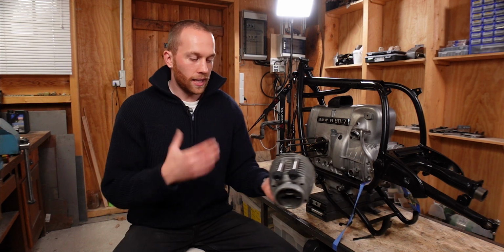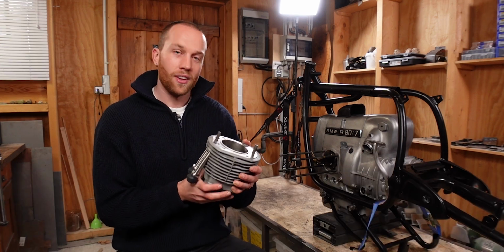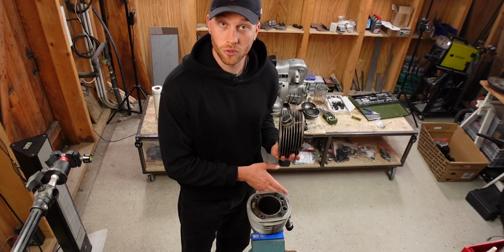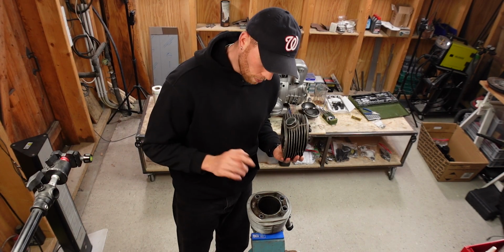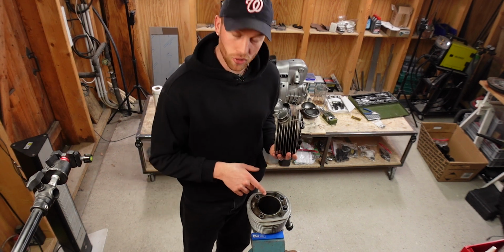But over time, I gained a lot more confidence, and now tackling the pushrod tubes, for example, is something that I definitely dare to do. But I didn't expect to find more problems. I haven't even started to touch the pushrod tubes, and I just took a peek at the cylinder walls. And unfortunately, you can see that there's not much cross-hatching left.